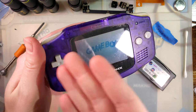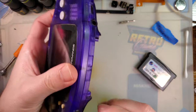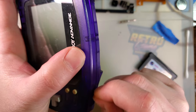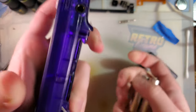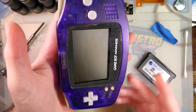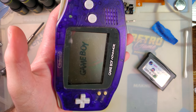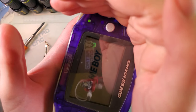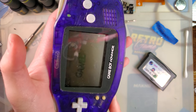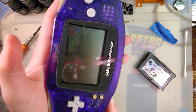You can see mine - I can get it to boot by fiddling with the power switch, and I haven't even taken this thing apart yet. I'm going to pop the batteries out, jiggle this switch back and forth a few times - not excessively, but quite a bit - then switch it off and pop these batteries back in. See, it's not doing it. Sometimes that works. But at the very least, notice I can get it to turn on and I have that green power light - I just have to put the power switch in a specific place. But either way, it's still getting better.